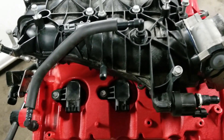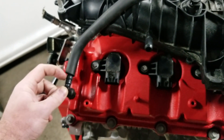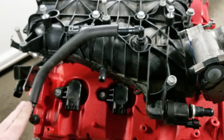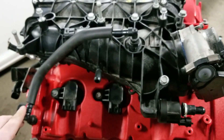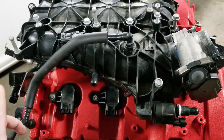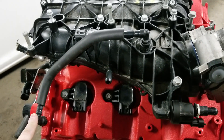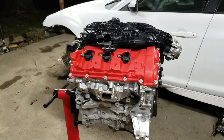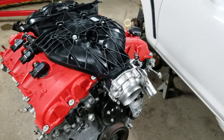What I'm going to do is cut the PCV hose here and use the piece that goes into the manifold — it has the same flange. On the valve cover side I'll cut it here and run a hose over to the firewall or fender well and put an oil catch can in there. If you don't want to do that and just want to use the factory piece, the Camaro PCV piece is about nine dollars and fifty cents in the US — I'll put a link in the description.